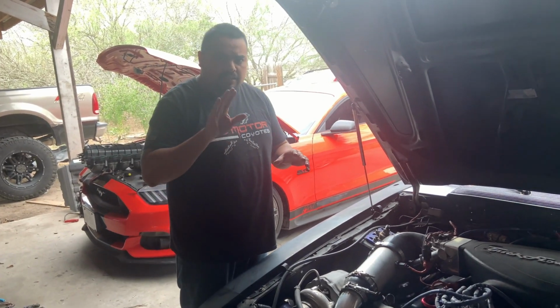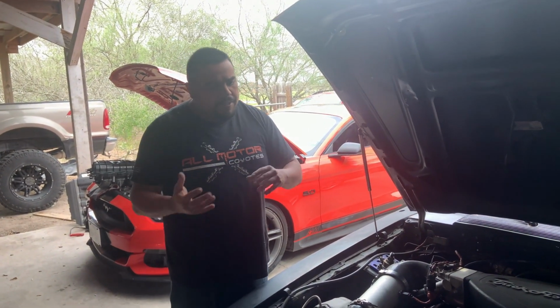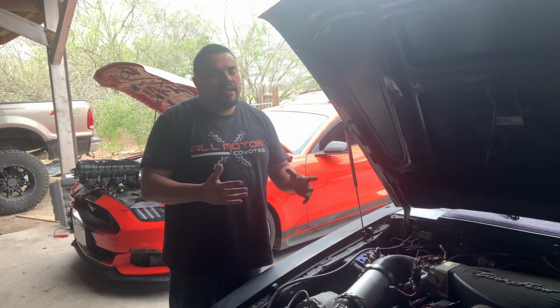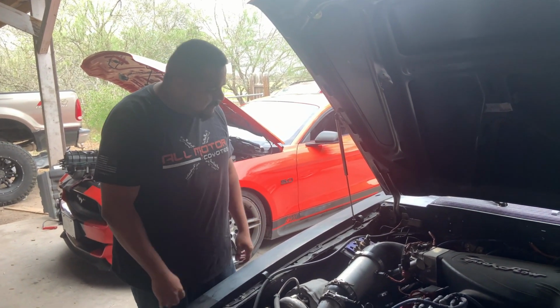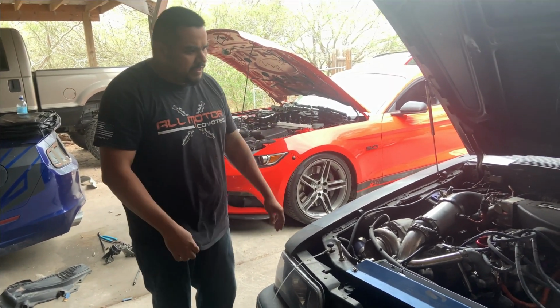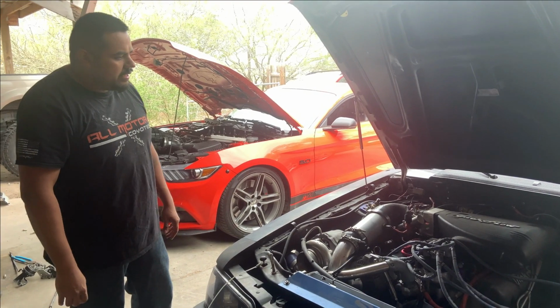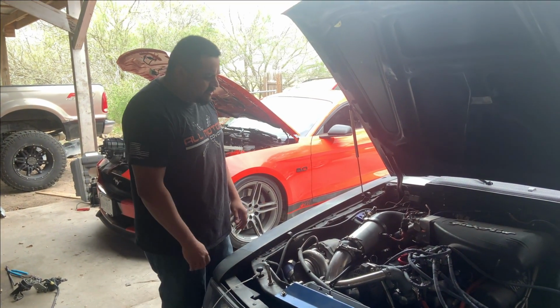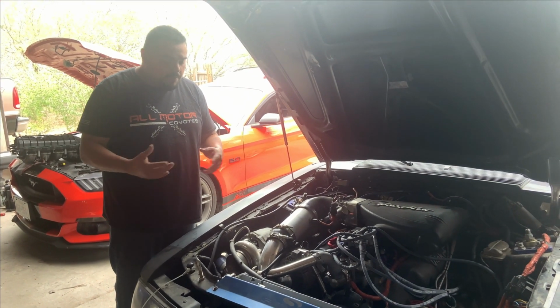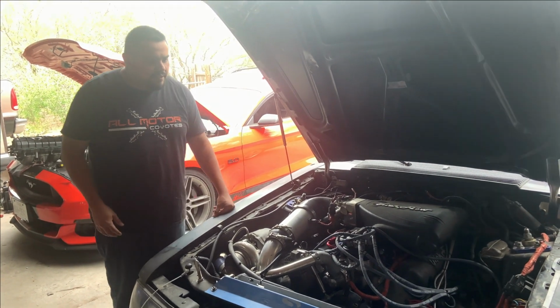And once you really started getting into load, then we go into where we're commanding it to richen up, you know, for boost and stuff like that. And that richens up. So that's fine. It's just the rest of it back. That's one way to go ahead and check it. But like I said, outside of that, everything seems fine. I'll just go ahead and replace the plugs for a one step colder, get it tighter.